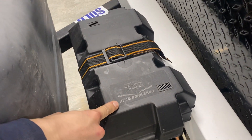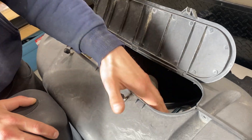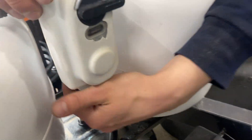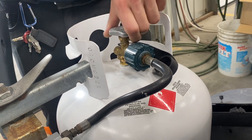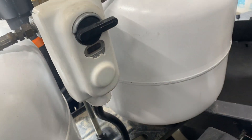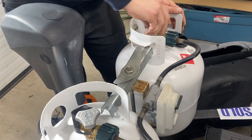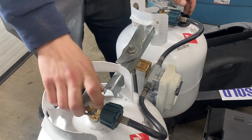Inside this box here, you'll find your battery. As long as you're plugged into that shore cord in the back or your seven-pin into your tow vehicle, that battery is charging for you. Underneath this cover, you get access to your two propane tank valves. In the back, you can see the changeover. Currently pointed over to this tank — open this tank up and that'll be it turned on. Watch that changeover; it should turn green letting you know propane is present. If it's red, there's no propane, so just turn it off, flip the arrow over to the other tank, and run off that while you get the other one filled.